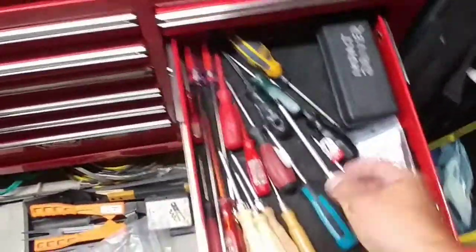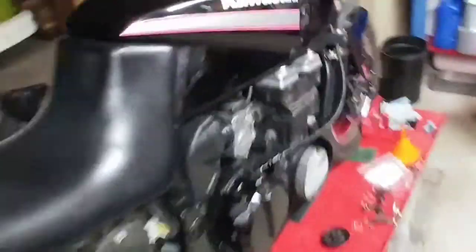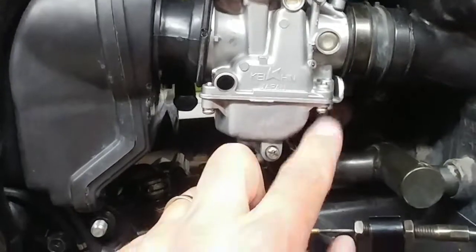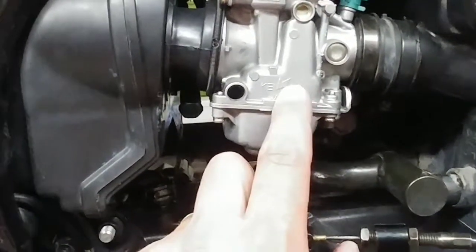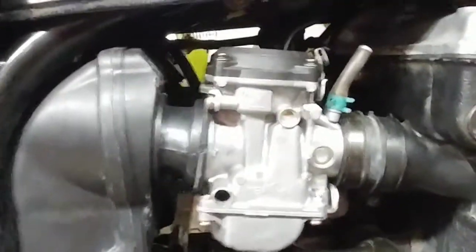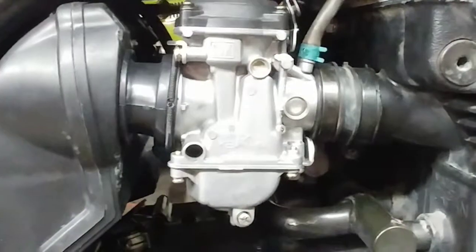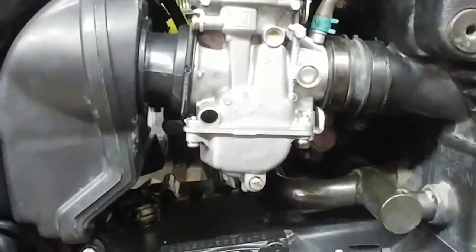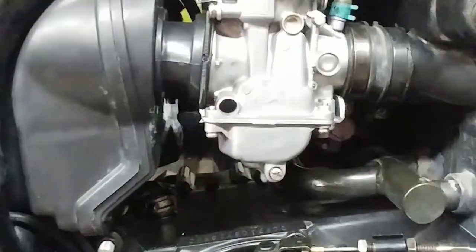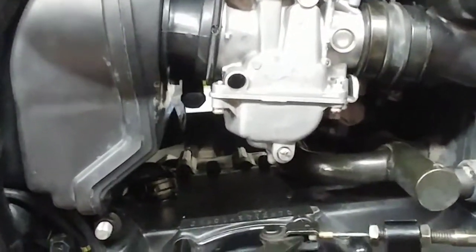So far they have helped me on this motorcycle — the carburetors, those Keihin carburetors. They have tons of those little Japanese screws on them. They all look like Phillips but they are not. In some cases they were already kind of stripped. So I used those Vessel screwdrivers to get the old ones out, replaced a few, and they seem to be working really well. I'll put the link in the description. Each was like 10 or 12 bucks — they sell them in kits as well.